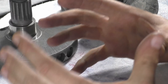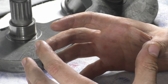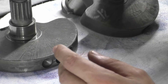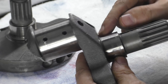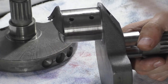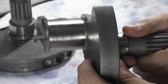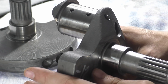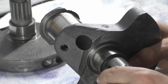Forgings are stronger simply because you are crushing the hot metal. You're basically not trying to force out inclusions — what you are forcing out is any voids where the metal is loosely bound. The grain structure also follows the contours instead of just where you machine and cut across them. It's a bit like wood grain, and I'm literally going to do a video about that using a bit of wood. Forgings are more expensive initially, but in the long run forgings can actually be just as cheap almost as cast components.